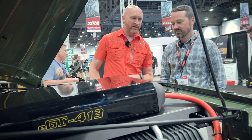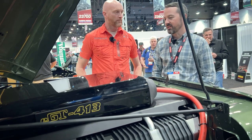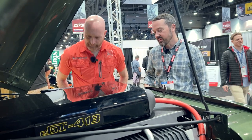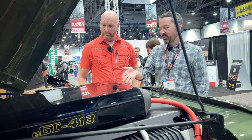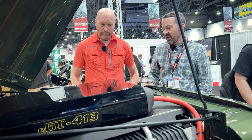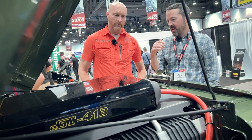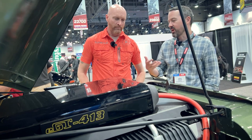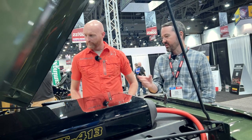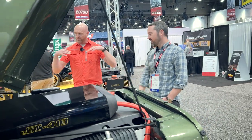What else is really cool about this? I get asked — with this much power and torque, surely you had to do a lot of fab work or heavy-duty specialty parts. The answer is really no. This system bolted to the factory motor mount locations, factory transmission mount locations, factory axles with the same sort of upgrades CJ guys have been doing forever. It's about 250 to 300 pounds heavier than a gas drivetrain, but that's not enough to require specialty suspension. I have a really popular BDS suspension kit — a two-and-a-half-inch YJ conversion kit — which is more than enough. And the stance is beautiful.